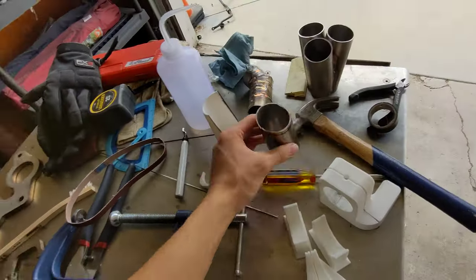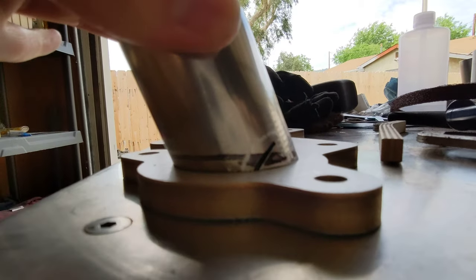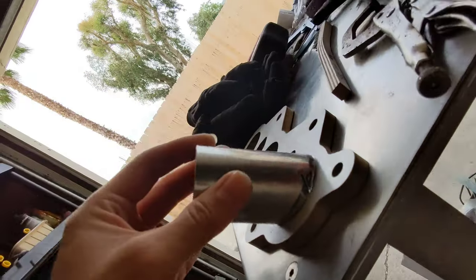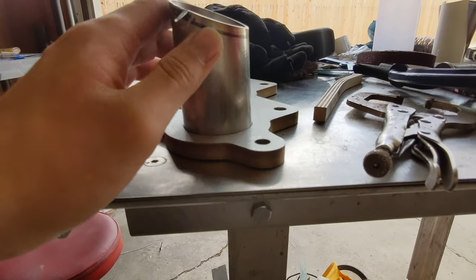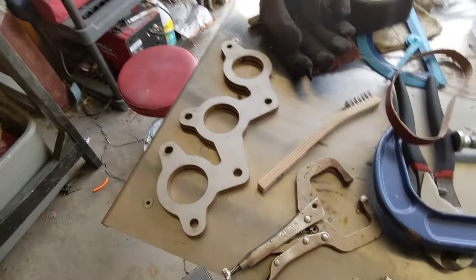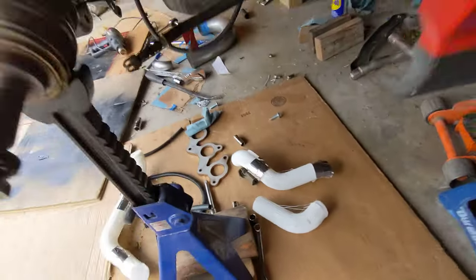The ports do come out at a 21-degree angle — I did mention that in the last video. But it is honestly pretty significant how sharp of an angle that is. Let me pull up this flange. It's honestly pretty crazy how sharp of a bend it is straight out the head, because technically coming out the head it's like a straight line. But having a perpendicular cut on the flange, it's kind of crazy how sharp of a bend it has to do with straight out the head. That's just some cool stuff that Mark figured out when he did the cross-sectional cuts.